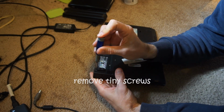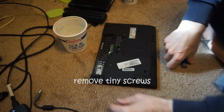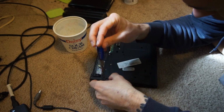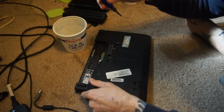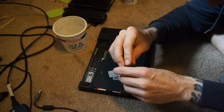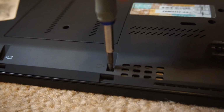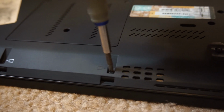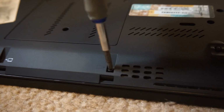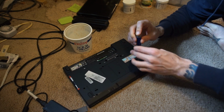And then reading on the forums, I find out that this particular computer, this is a Lenovo X230, some of the Lenovos in general supposedly have issues like this due to a lack of thermal compound or thermal paste, or not enough thermal paste on the heatsink. So I thought I'd take mine apart and see if adding some extra thermal paste would alleviate this issue. And spoiler alert, it did.